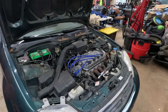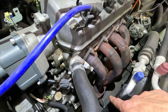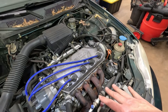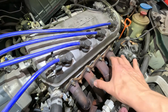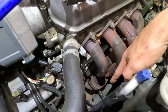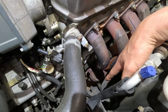We got the hood popped on our car. Here is the O2 sensor right there. This does have an aftermarket header on it. If your car has the original manifold, there will be a heat shield here — you're going to have to remove the heat shield, and the O2 sensor will be in that area. This one is before your catalytic converter, so mine is right there.